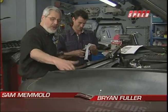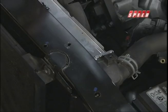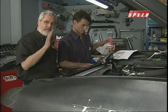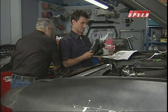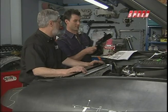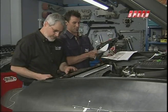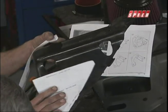We're continuing on with our Banks installation. We've got our intercooler in, so it's got the core support back on, and it fits between the radiator and the AC condenser. When you're doing this kind of work, the first thing you want to do is disconnect the batteries — and this diesel has two of them. That way you don't arc against something. Some modification may be necessary; there are templates in the instruction manual you cut out. Just align with the little tabs, trim it out, and we'll show you that.